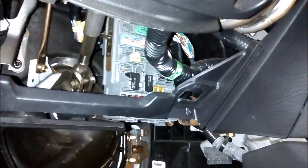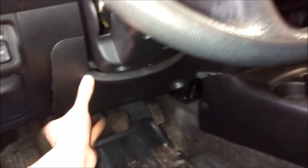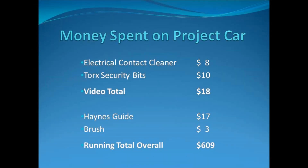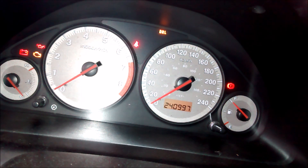Last thing — install the cover back under the steering wheel. On both sides it hooks in, swings up into place, and then rotate the clips back 90 degrees clockwise. To fix the SRS issue, I spent $8 on contact cleaner, and I had to buy Torx security bits since I only had regular Torx bits — grand total was $18. I also spent a couple of dollars on a Haynes guide to help understand issues on this project car. My running total on this project car is now $609. And that's how you fix the SRS on light when the code is 9-3, driver seatbelt.